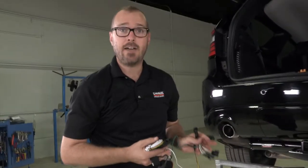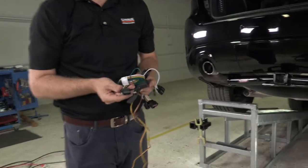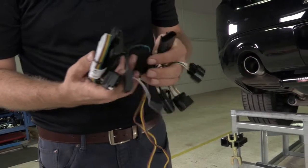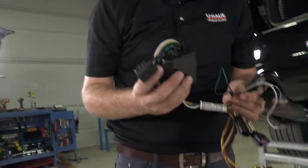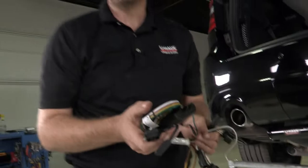Hi, I'm Sperry Hutchinson from U-Haul, and we have been working on this Dodge Durango to get it ready to tow a trailer. When you're towing a trailer, you've got to have trailer lights. To accomplish that, we're going to adapt the factory wiring from this Dodge Durango out to this four-way flat plug that's going to provide your turn, brake, and running light signals on your trailer. We've got these two connectors on each side that are going to tie into our tail lights, a ground and a power wire that's going to power this converter, and of course the four-way flat that's our trailer harness end. Let's show you how to install this.